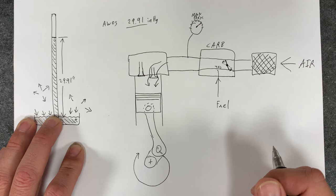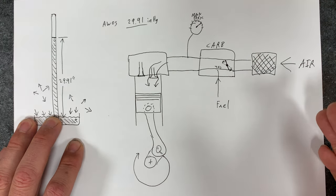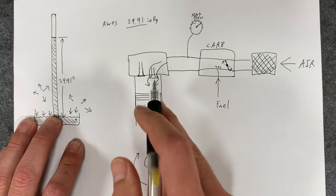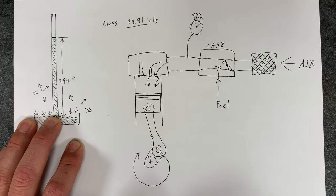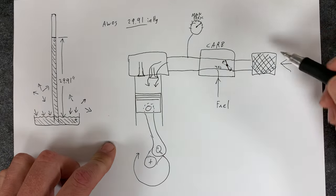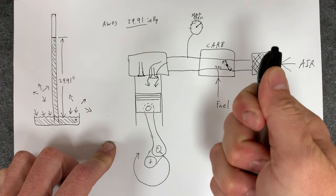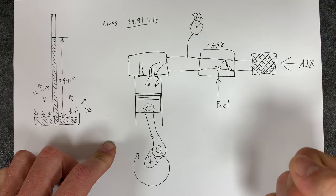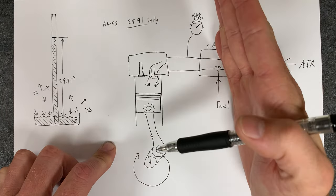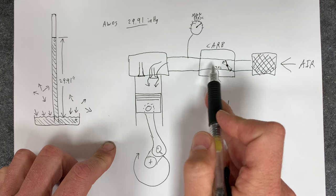The valve is metered so that when it's closed, let's say your engine idles at 700 RPM. The reason it doesn't idle at 1200 or 200 is because there's just enough air going through and mixed with just enough fuel to have just enough combustion to run it at that speed. That valve right there is what regulates the speed of your engine — literally the power of your engine, which also regulates the speed. When you get in your airplane and push the throttle forward, what you're doing is pushing a cable connected to an arm that opens that valve. By opening it, you're allowing more air to flow through. The carburetor mixes more fuel with that air and you get more power in the cylinders.